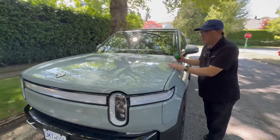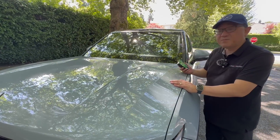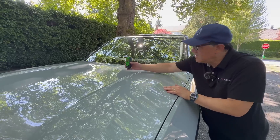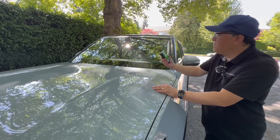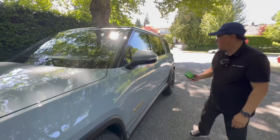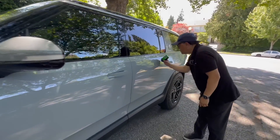In the case of Rivian, it's pretty well aluminum pieces here. Obviously, the thicker the paint the better in terms of long-term reliability, but as long as it's between 100 to 150 microns, it's okay. Let's measure: 147 for the hood, which is actually pretty good — nice and thick. 106 on the front fender, and 106 exactly the same again, which is a good sign.